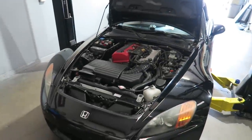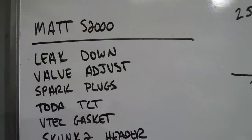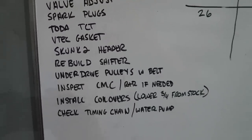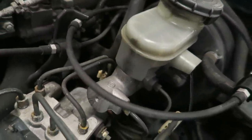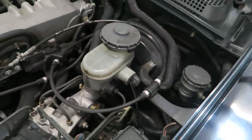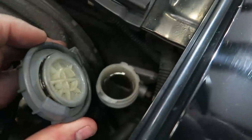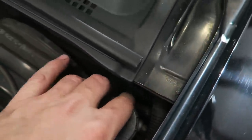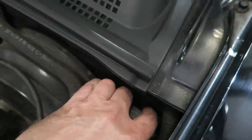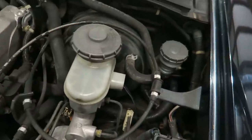We've gone over the list - this customer came from Orlando. We're going to work through his list and suggest extras if needed. At a glance, brake fluid is pretty dark - this might be a separate project doing a full brake job. Clutch fluid is really dark too. Like we've shown in past videos, the first thing to do is check the master cylinder to make sure it's not leaking before you waste time flushing it, because if it is leaking it's going to continue to leak.